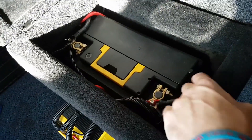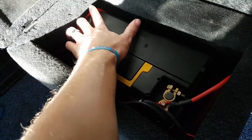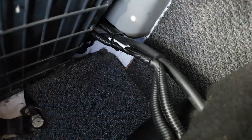You can see here we've got our battery cables — our earth line and our positive from the main starting battery, and obviously we've got our positive here from our auxiliary battery, and all of that is just routed out of the back of the battery box to where it needs to go.